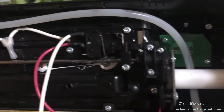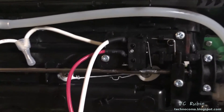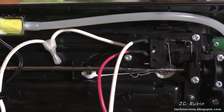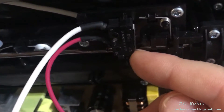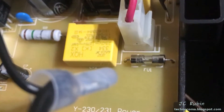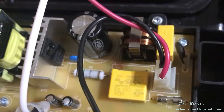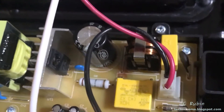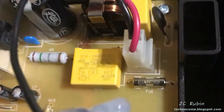The first thing we see as I open it is an actuating switch right here — there's the on/off switch. Forgive me, I don't have my gimbal here since I wasn't planning on doing this, but I'll demonstrate. We can see that actuation right there — that would be something to test. The switch sounds good, nice positive click. Looking at the main board, there's a fuse right there — that begs the question, is that fuse good? It looks like main AC power is going right through here, so that fuse is a potential culprit after just a two-minute inspection.